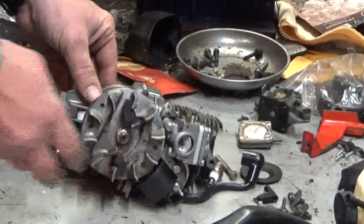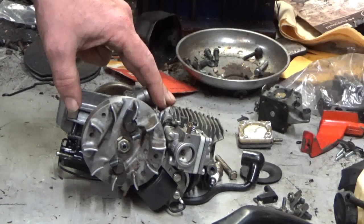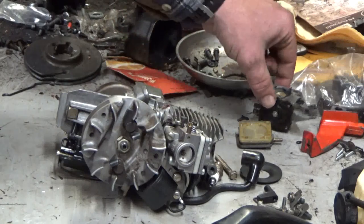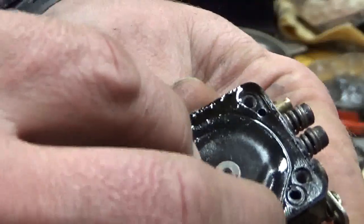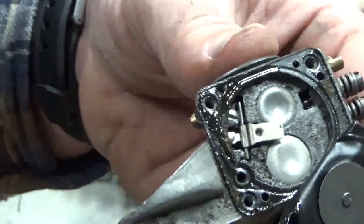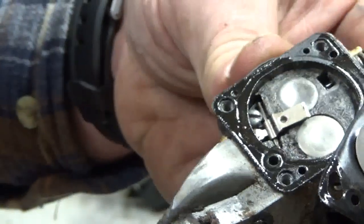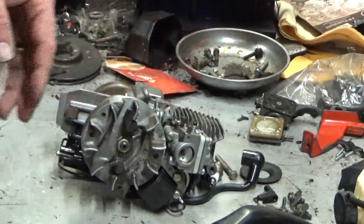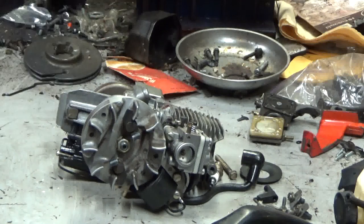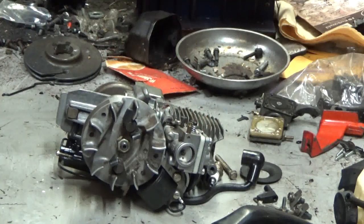Now this is a short gun. It's already together. The only reason I took it apart was the carburetor. I was pretty much certain that there was going to be something wrong in it, and I was right. I wanted to rebuild it, and I would have done that on film, but I might have this zoomed in a little too much. See if we can get a focus inside of there. See all that corrosion? This pitting down in here? I have no confidence that that casting would hold gasoline. So that got put to the side, put a spare carburetor on, and it appears to be a new takeoff. I don't know where I got it, whatever. We're going to use it.